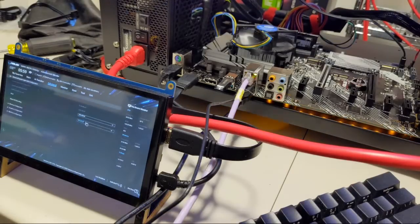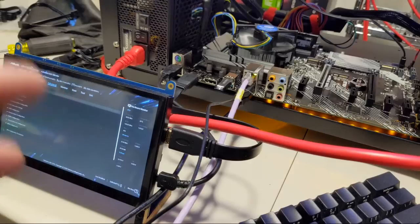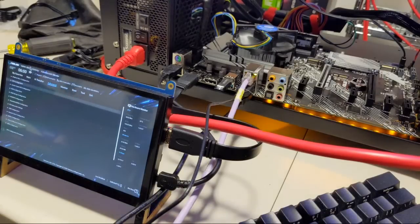Okay, I think that's it. You guys can see the 4G decoding is right there. So that is good. Really the only thing I did was 4G decoding is enabled. PCIe Gen 1. We might try Gen 2 later. But like I said, we're going to be testing it out with Windows just temporary, just so we can see the thermal temperatures of the memory temperatures on the 3080s.